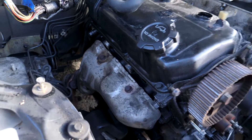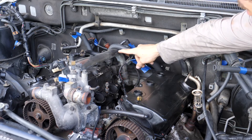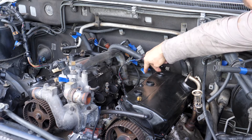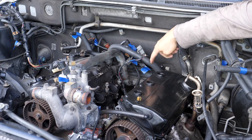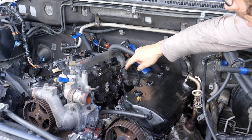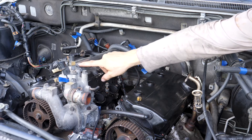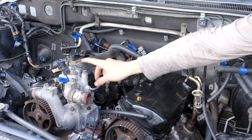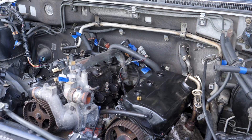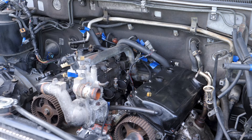The major things I'm going to do today are take off this water pipe that goes back here behind the heads, because it's going to be easier to get the gasket in there if I can just take this off. There's a bracket over here, and then it attaches to the back of the head — I believe these are just inserted O-ring fittings.